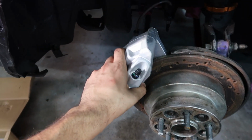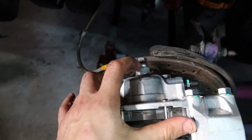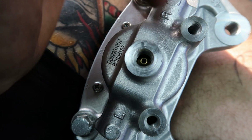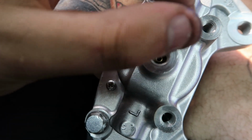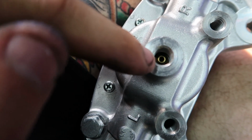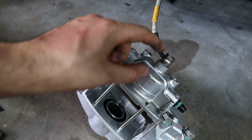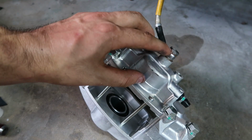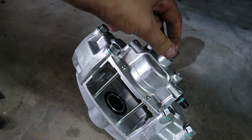And if you look right here, no, this isn't bolted up, it just fit. My OEM rear brake line actually threads into here, and if you look at this little brass piece in here, that is for a hard line fitting to thread on and bottom out on to seal. I have an OEM banjo bolt that threads in just tight enough to actually seal the crush washers instead of having just the hard line seal it like that.